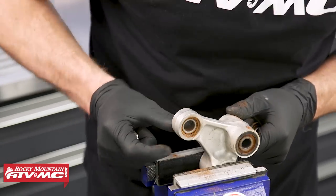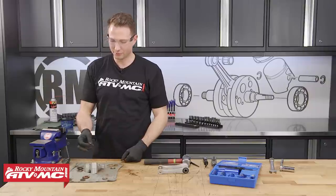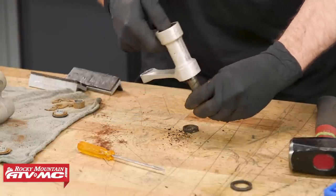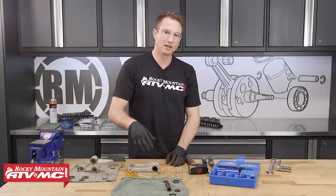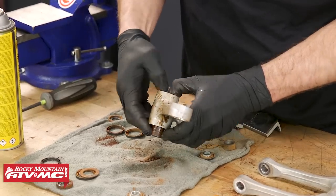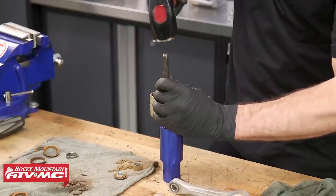As you can see, these bearings were long overdue for service — completely dry and rusty. Dust seals? More like rust seals. If a pivot collar is difficult to remove and doesn't want to come out, you can use some penetrating oil and let that soak in to help free it up — that's exactly what we'll be doing on the shock arm. To get the bearings out, we need to remove the pivot collars using a drift and hammer, then use the Motion Pro tool to remove the bearings.